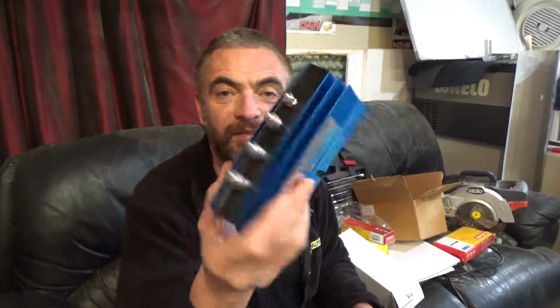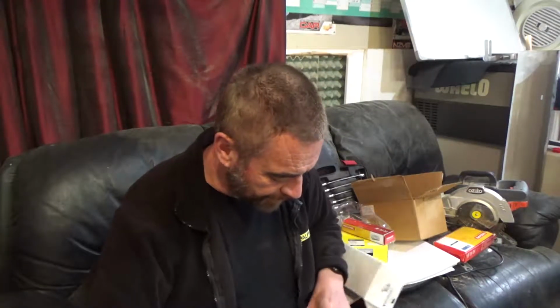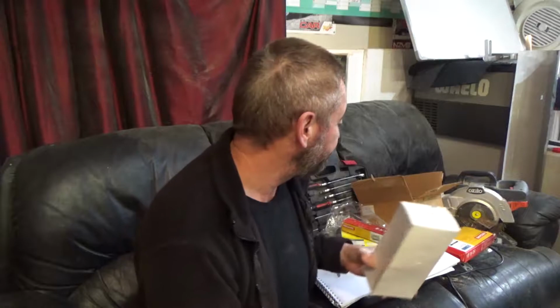Now the thing is, I bought a kind of a random box of stuff. So I have a couple of battery isolators, this is 12 or 24 volts. It's a bit like a VSR, but you can also control it from the ignition, and it enables you to have a house battery on one circuit and a starting battery on another circuit, and charge them both at the same time with the alternator.